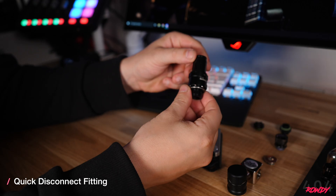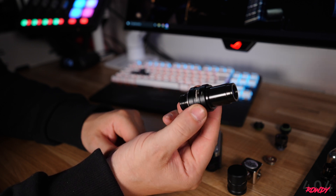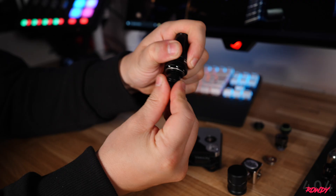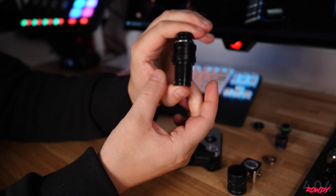Another fitting that can be very useful especially in a soft tubing loop is quick disconnects. These can be an absolute godsend but also a giant pain. The ones I have here are Barrowch quick disconnects — they allow you to disconnect the loop without draining all the fluid, which is great if you're swapping components frequently. The reason I say they can be a pain is that on one fitting in particular you have to make sure it's fully pushed in, because if it comes out ever so slightly it can restrict flow to almost nothing and cause temperatures to skyrocket. Only use quick disconnects if you really need them.